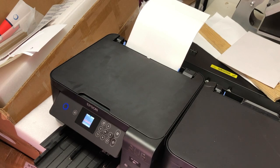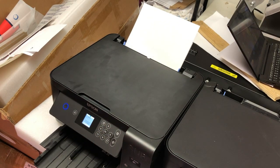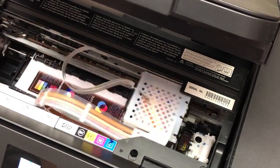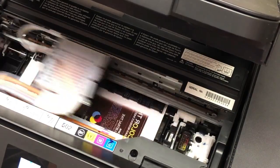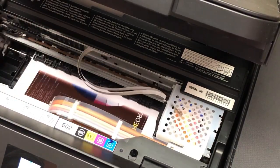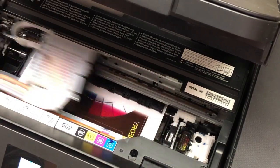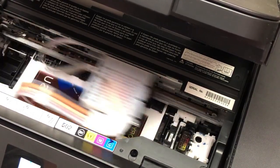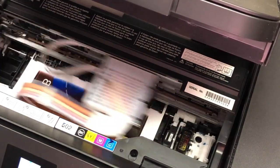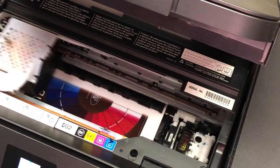If you don't have a modified BCH printer, you might have some problems with paper feed where the print head strikes the film. What you can do is avoid printing images that large and move your images around, make them smaller. A better solution is to get one of the modified EcoTanks from BCH. By modified, I don't mean modified for sublimation — you need a printer modified for DTF printing. The difference is that DTF uses a lot of ink, so you want one modified to remove the star wheel so you won't have a star wheel problem. You'll also need a flat paper tray to catch the film and keep it flat.